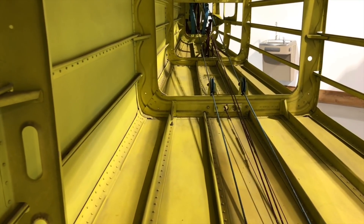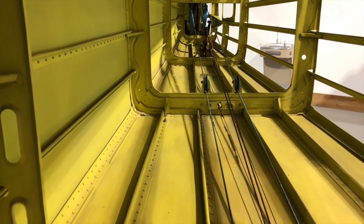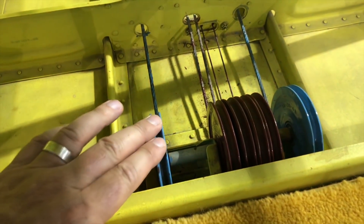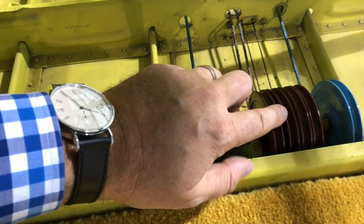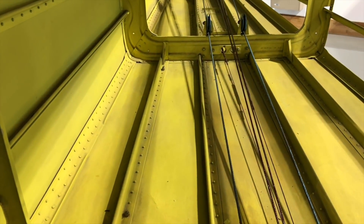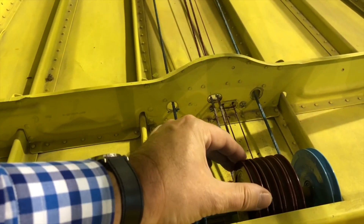This is how it looks behind the bulkhead where you would normally have a compartment wall. These pulleys — somebody mentioned it's nice to rotate them 180 degrees at annual, so the cables wear at different areas of the pulleys as opposed to the same area. I think that's a good idea. You could certainly do it on these, and probably on some of the others through the inspection panels — just rotate them by hand, index them differently, and then the cable runs on an unused area of the pulley for more uniform wear.